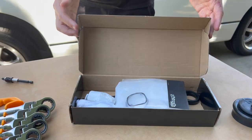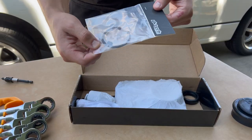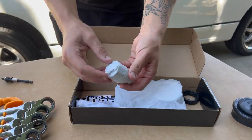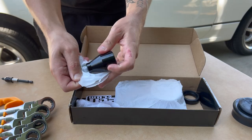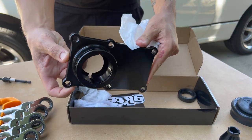Right out of the box we got a new wave washer — that's going to prevent some leaks in the car — a new circlip and grub nut. I'll show you exactly where this goes later. This is the shift boot mount; it's a nice one solid piece of aluminum. That's where your grub nut is going to go, and this is where you're going to zip tie the shift boot so it doesn't have any slop or play in it.